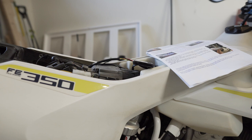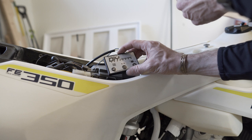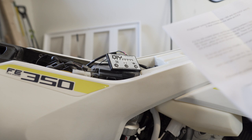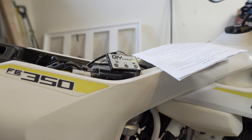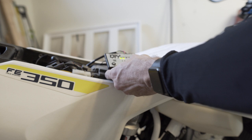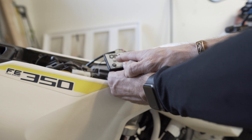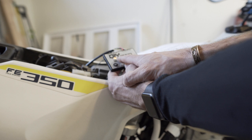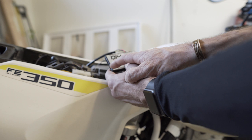All right, guys, I got the instructions here for the tuner box, and I'm gonna turn the bike on now, and I'm gonna go through the settings for my power bundle, which are outlined here in the back. If you have the intake reeds and the power reeds, then these work well. So we're gonna try this out. Haven't done it yet. Let me see what happens. All right, there we go, she's blinking. Press the mode button. So the green is now on 4 and 5. So we want to move the green to 4, like he said. So we'll put it to 4. And now we'll do yellow, put it at 2. So that's at 2. And now the red at 2. 2, done. So leave this stock, leave that stock, leave that stock.